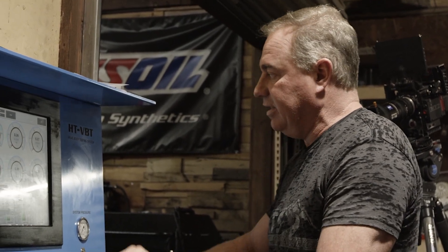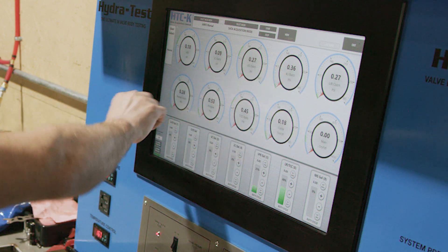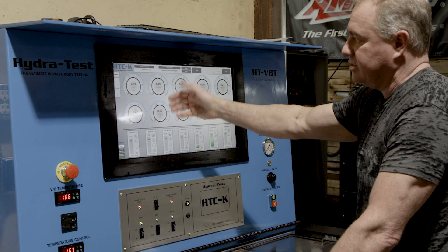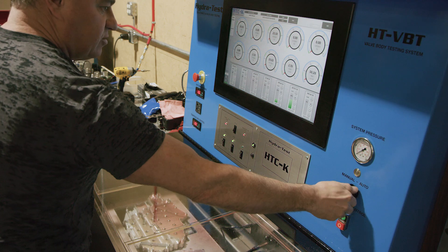It has no leaks, and one of the quick things you'll see is your underdrive clutch, your 2C clutch, your overdrive clutch, your 4C clutch, your low reverse clutch, and reverse input. These are essentially clutch packs that are going to show us the hydraulic integrity, and then these are the solenoids. As I get this thing fired up you'll kind of see what happens.